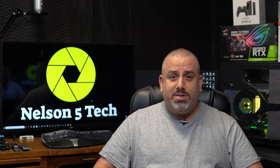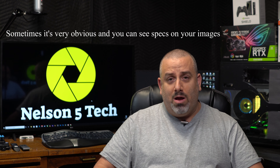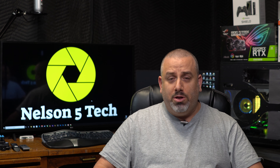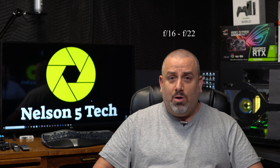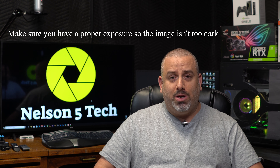So how do you tell if your image sensor has dust on it? It's quite simple. Attach a lens to your camera, set the lens to the smallest aperture that you can — say f16 or f22 — set the ISO to 100, and point the camera directly up into the sky and take a picture. Take that image back to your computer and open it up. Here is an example image of my Sony a7r III prior to having the sensor cleaned, and here is an image I took after I cleaned the sensor. Quite a big significant difference.